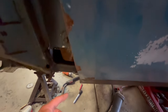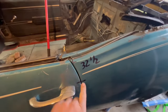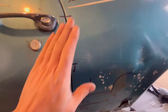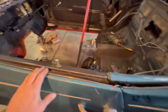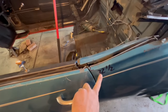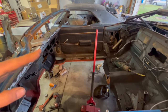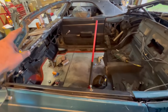My door still lines up with the front edge of that rocker panel like it's supposed to — that's looking real nice. The gap across the bottom is nice and even all the way to the back, so I think the elevation is good on the rocker panel. Door gap is even top to bottom. We're not pie-shaping in or out. Quick visuals — this is all looking exactly as I want it to look before I burn this thing in permanently. The last thing I want to check is the mark we made on the window frame — 32 and a half inches. I want to verify the windshield frame or cowling hasn't pitched forward or backwards.